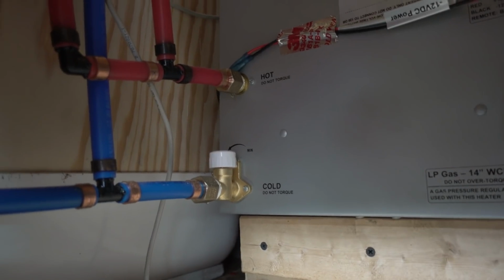And so yeah, we found leaks right off the bat. Then it was like, okay, we've got some leaks on the hot water heater, and that's when we had those brass fittings that we tried to use Teflon tape to mount to the hot water heater, and we quickly realized that's not working, and so we switched them out.